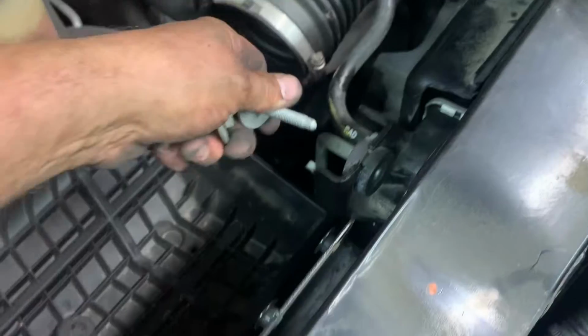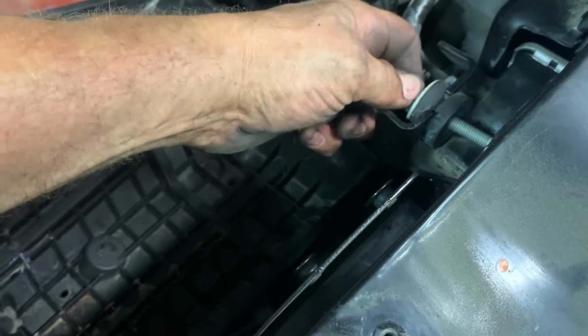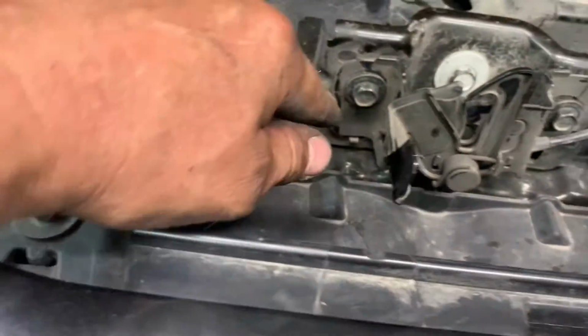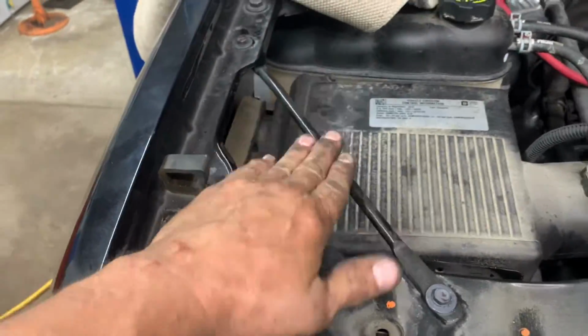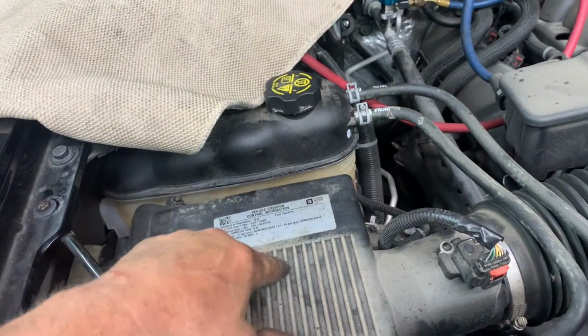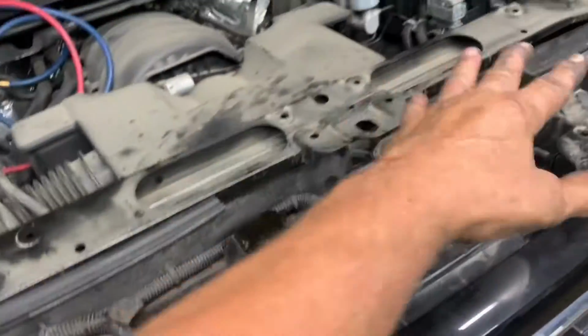And don't forget about your radiator bolts. Okay. These, put them in there. Get them started. And then tighten them up. Okay. Line up your bolts with the markings from the dirt. Don't forget these brackets, right and left. Got your air filter housing on, you got your 4 bolts, your screws tight, plugged in, your clamp tight. All right, now you need to put the top shroud on.